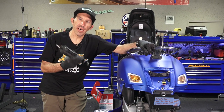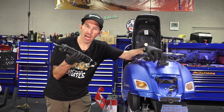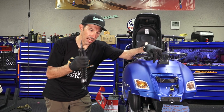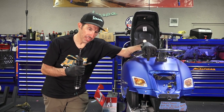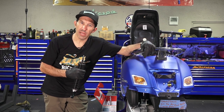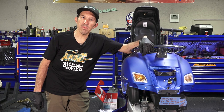That pretty much sums up replacement of the rear shock absorbers on your modern Vespa. It's a combination coilover unit with both the spring and damper built into one. The Primavera, Sprint, LX, and 50cc models have a single shock; the GTS 300 and larger frames have a double shock setup. All are similar in technique, requiring some bodywork disassembly. As for tools, just basic tools are needed, though an impact wrench — air or battery-powered — is very helpful. This is Rob from ScooterWest and Vespa Motorsport in San Diego, California. Thanks for watching!